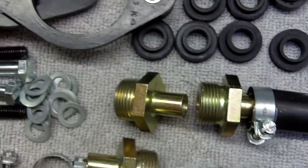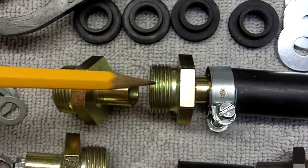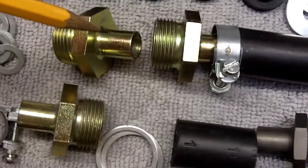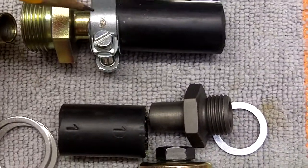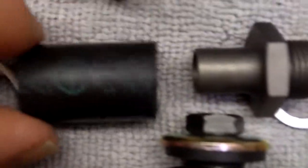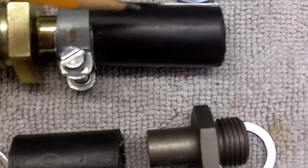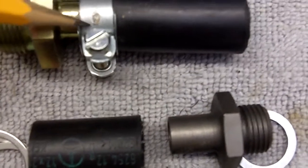At the same time you're dealing with the intake manifold, Joel indicated these nipples — these water nipples — are rotten and need to be replaced, and that's a common item. At the same time you replace these nipples, you're going to redo the hoses, and these are in fact factory hoses as you can see with the Mercedes logo. The clamps are just barely the right size — they change the dimension of the OD of the hose so that these clamps are very tight to fit on there.